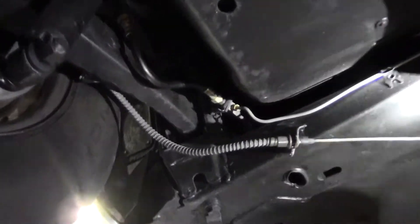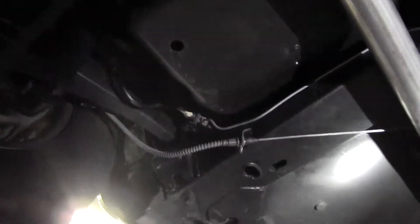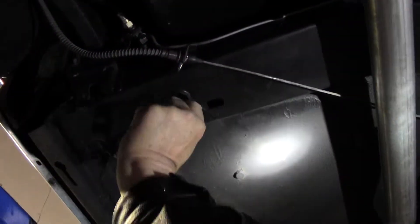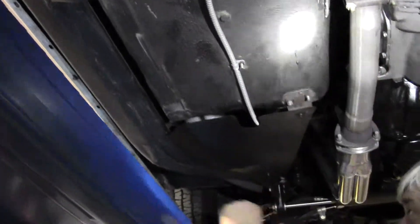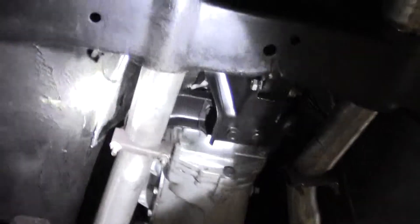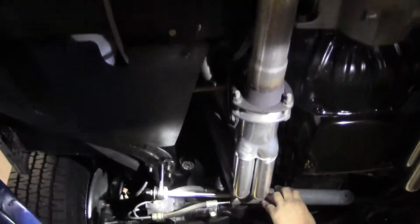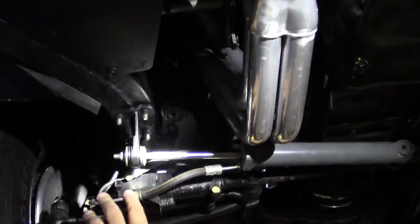We look at this area in particular, because this is where, if it was exposed to salt, it's still eating. I feel the thickness here, thickness of the tie-down holes, the metal, and also go all the way forward to make sure that the seam is correct and no deviations — like wavy, where it might have been pushed at one side or dented. You can also see from the front it looks like brand new power steering units here, no leaks.